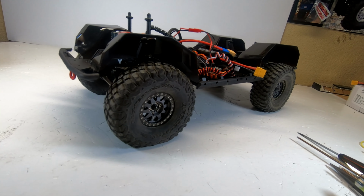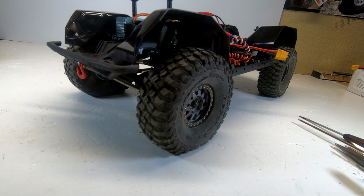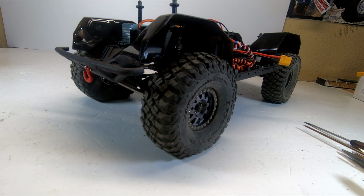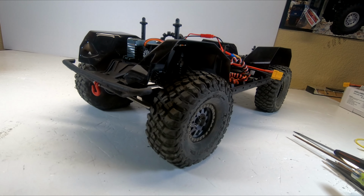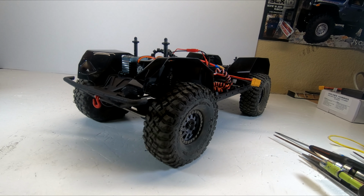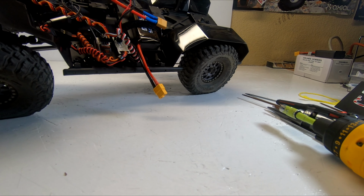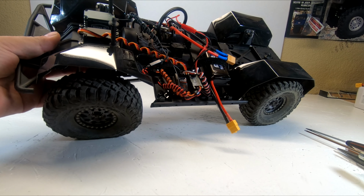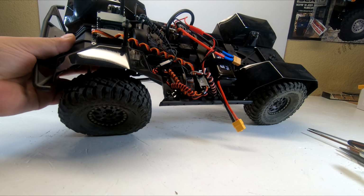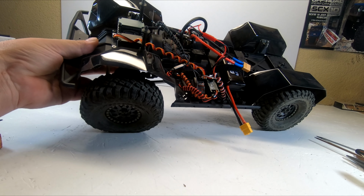Well, that kind of escalated quickly. Turns out I went to go test this servo and everything browned out. So I couldn't have any steering. I didn't have any winch servo even after a while, and everything kind of crapped out. So it turns out I need a BEC. I have an RX4 in this thing, and it has an 8-amp BEC internally installed, but apparently I was drawing much more than 8 amps. When you have a dig unit also, and you've got 3 digital, basically high-torque servos going on in the same rig, you need a BEC. It was surpassing that 8-amp BEC in the internal RX4.